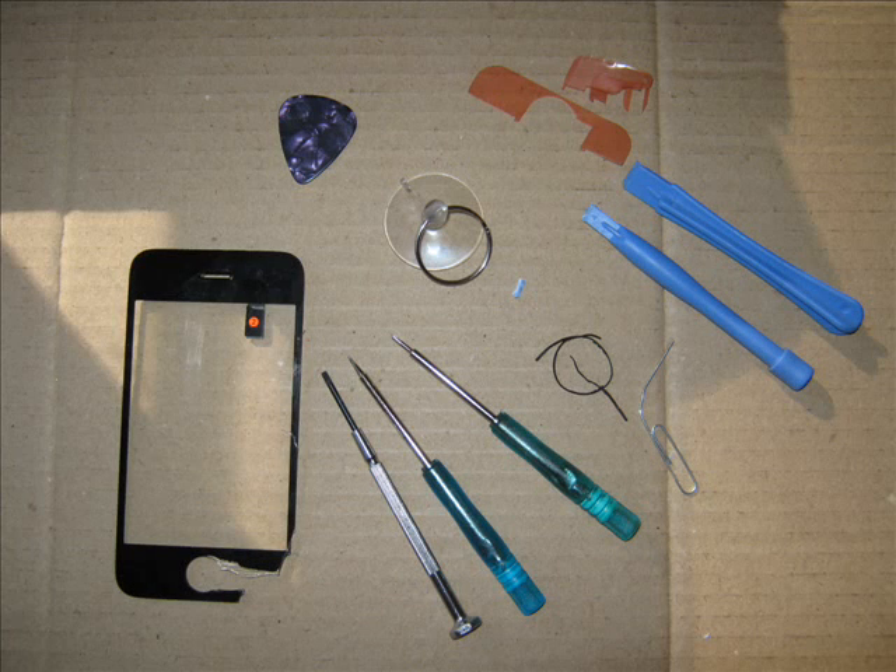This is a video explaining some of the caveats you'll experience when replacing the screen or the digitizer on the iPhone 3GS. Once you've removed the two screws at the bottom of the iPhone as explained in the other video, I recommend you use the suction cup tool, not the pry tool, in order to pull the digitizer away from the iPhone.